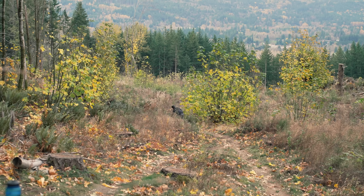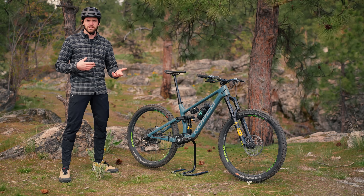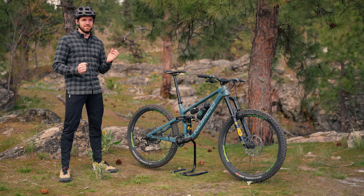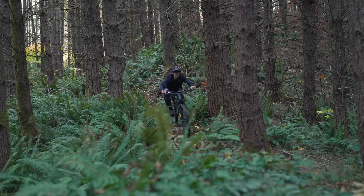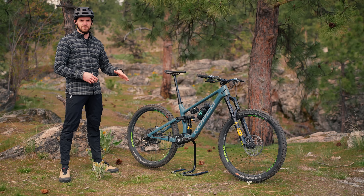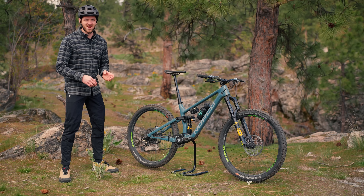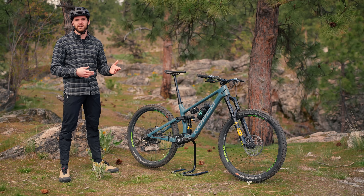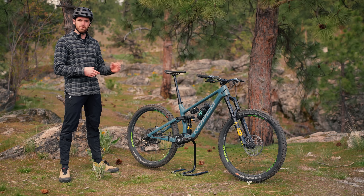When I got the shock I found I actually couldn't get the rebound slow enough — not sure if that's attributed to the Norco's linkage or if it just wasn't the right tune for me. It so happened I did have an issue with the shock: I cased a very large jump and after that the compression damping was just off — didn't feel like it had any, and rebound did nothing. I sent the shock back to Ohlins, they fixed it and gave me a new rebound tune, and since then it's been absolutely flawless. That was on my third ride, so it was pretty new. This was majorly user error — a 25 or 30-foot step-down I just didn't have enough speed for.